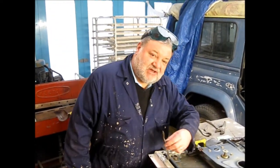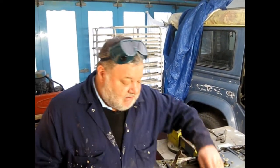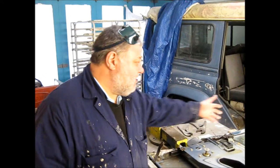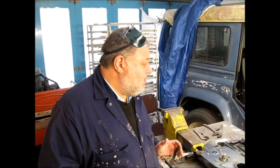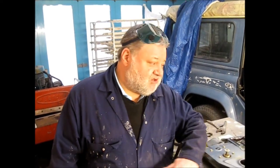So we've reconditioned the check strap and refitted that. We're now just applying a little bit of filler to smooth it out, and then we're going to prime all the inside edges of the door ready for top coating in blue. And in the meantime we'll be getting on with the other side of the outer door skin to straighten the slight undulations on the outer door.